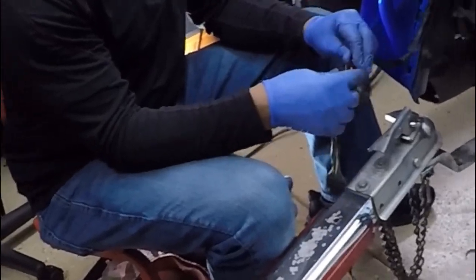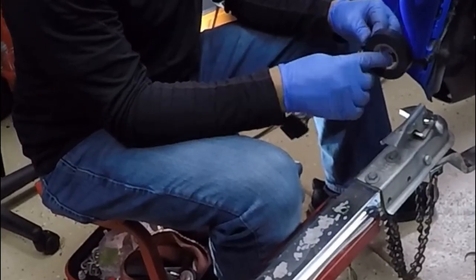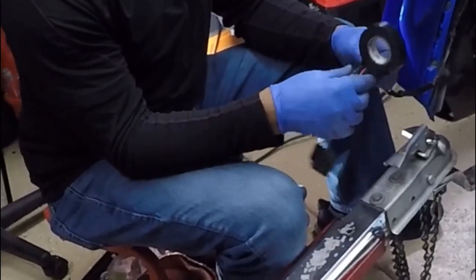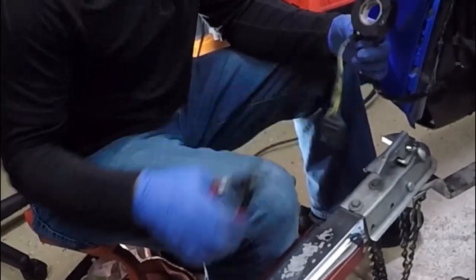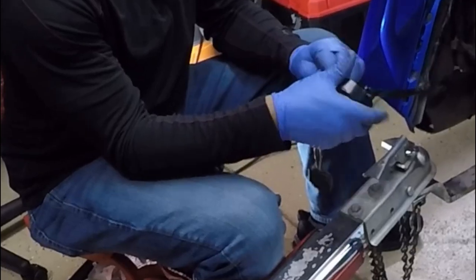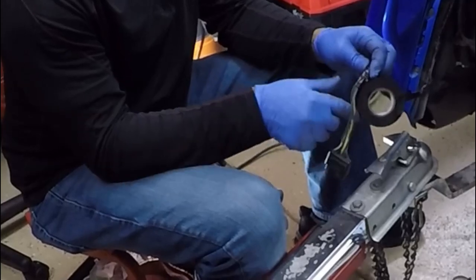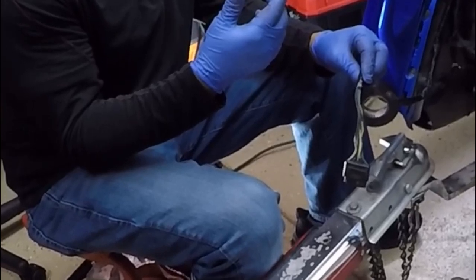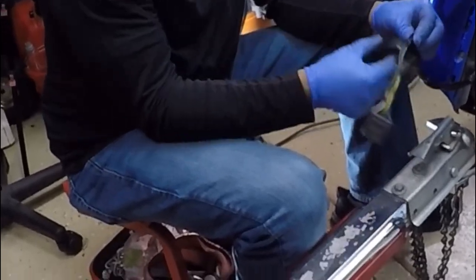We're not even going to connect the red one — it's optional, you connect it at the other end, so it's not hot. To be safe I'm going to leave it. So we know that six wire is in there — if you ever need it, you just know you have a six wire in there. If you want to put a dome light or some lights on your trailer that you want to switch on, you'd use that six wire for that.